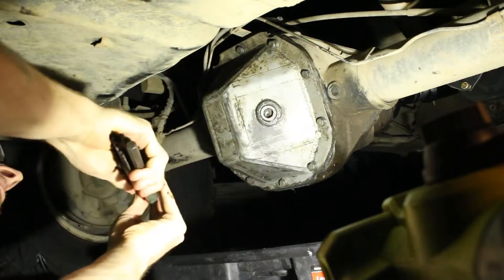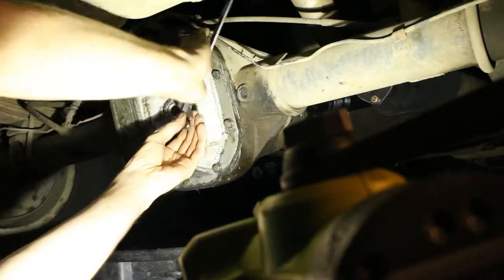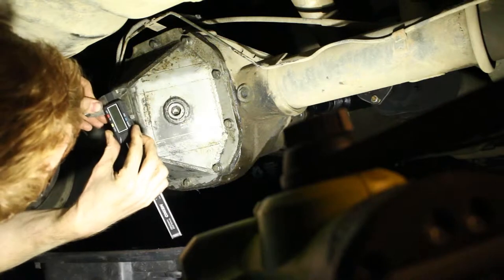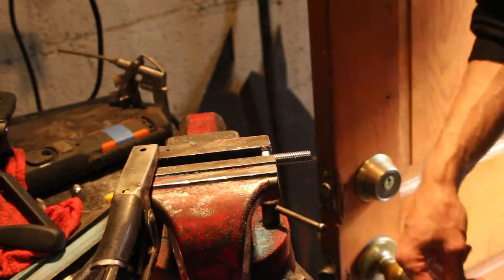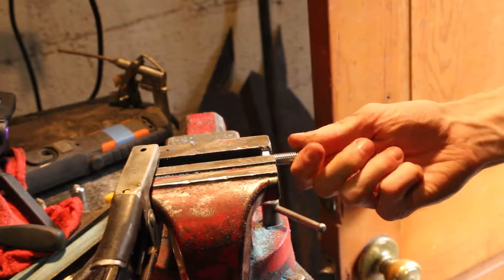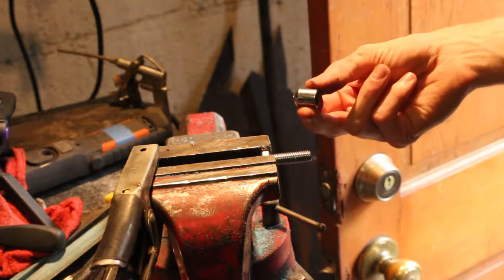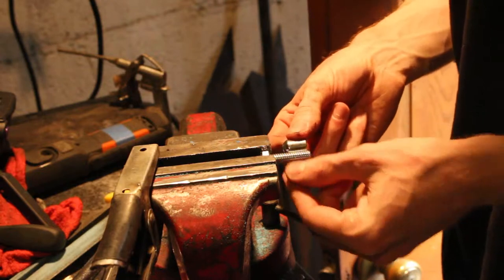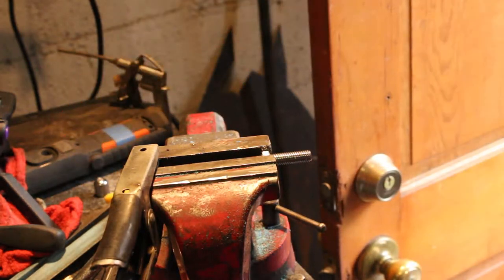This is the point where I realized I didn't have the right tool for the fill plug. Since I don't have the tool, I measured it — that width looks like 14, 14.5 millimeters, or 9 sixteenths. So it's a 9 sixteenths hex. I tried to get a 9 sixteenths Allen wrench but couldn't find one for a reasonable price. I found that a half-inch bolt has a 9 sixteenths cap area. So I saved this broken socket adapter and I'm going to weld that onto the bolt — it fits perfectly inside the fill plug. I'll grind it to a reasonable length, clean it up, weld it on, and hopefully there's my Allen.